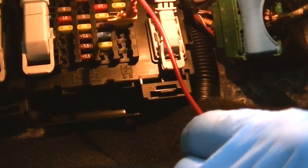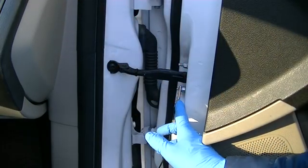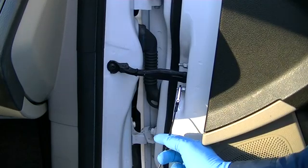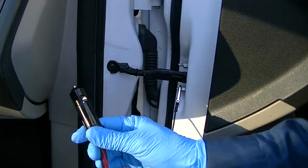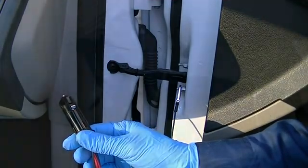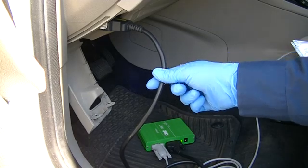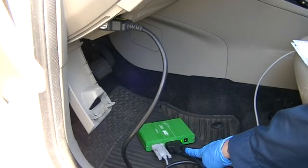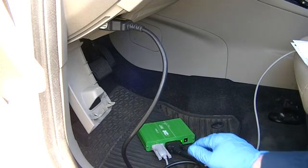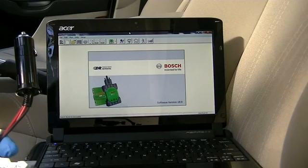Usually there is no indication if you are on the correct side; however, if you are on the incorrect side you might see noticeable indications ranging from dash lights illuminating, to door chimes, to the radio playing music. I still have the ground wire of the repowering device connected to my door hinge bolt for my electrical ground. I also do not have the repowering device plugged into a source of power at this point. I've already connected the CDR interface to the vehicle using the data link connector, or DLC. The green light on the CDR interface is illuminated because I have good power in the vehicle.